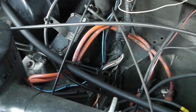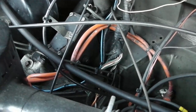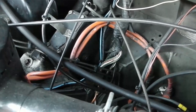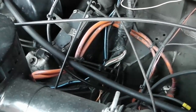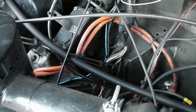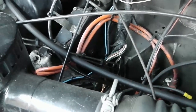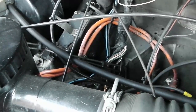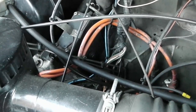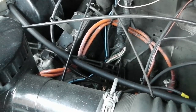You can see way down in there the red battery cables. I've never been happy with the routing of them to my isolator switch — they're in danger of chafing on things, which is dangerous. I can do better now, so I'm probably going to run them down to the chassis and along low down. That's one of the items to be attended to.